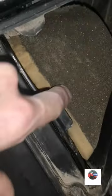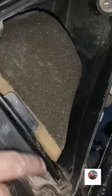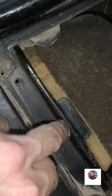At least I'm showing it on the video, because I haven't got none of the sponge stuff, and that means I'm going to be ordering it. But if it starts up and it's not drove through mud, I've cleaned all this in here, so it's not going to be sucking nothing through here up past this. But it'll definitely need a bit of sponge on there. But like I say, I said in the beginning of this video, Yamaha don't make them. I normally make them out of sticky sponge myself. But anyway, we'll get the cover on.